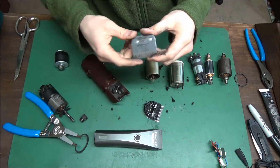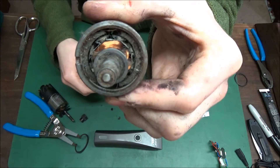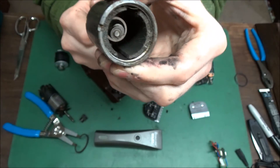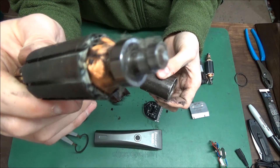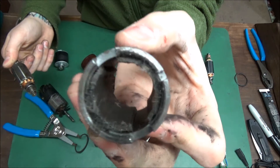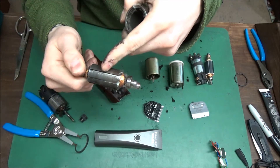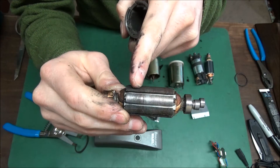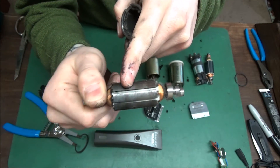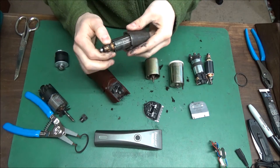Even a magnetic motor without a fan gets hair in it — you need to clean that out. If that never gets cleaned out, it just runs with all this debris. You can see there's wear and tear on the edges where it's rubbing carbon or hair, and that will cause more heat.